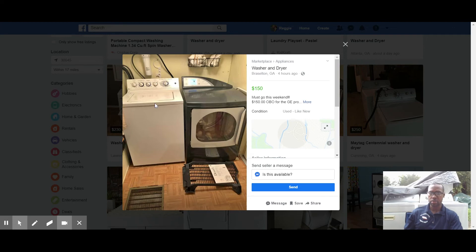These Maytag-style machines always have transmission issues. On this GE washer — when you check it, look underneath at the bottom panel. Don't bend that bottom piece, because when you put a full load of clothes in, it'll hit the bottom and start scraping. You take the panel off — there's a clip here and a clip here — use a flat-head screwdriver or a putty knife to open the panel, then use your boot or a hammer to push it back down. Sometimes when you take the screws off it'll sag a little bit.